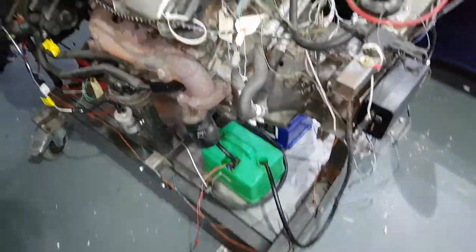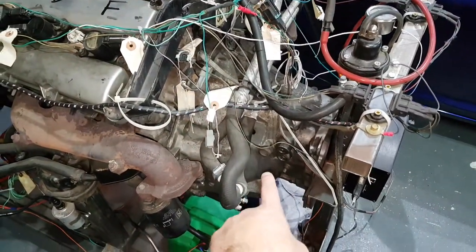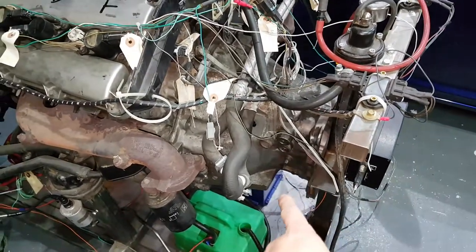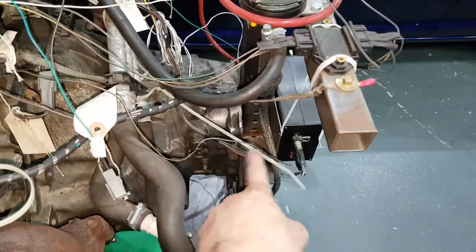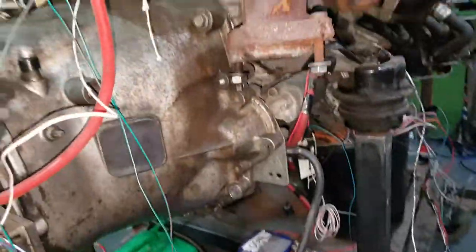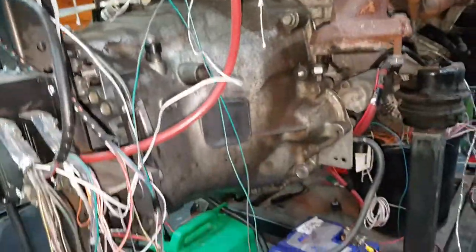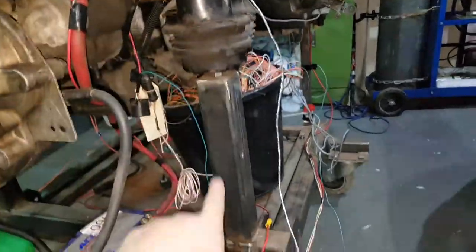Gav made the engine stand — got a design offline so he made that himself. We had to sacrifice a Jaguar 5-speed manual gearbox to make this work, which in hindsight is maybe a bit of a mistake because they're quite rare, the 5-speed manual gearboxes. We actually had to split the gearbox, which was a nightmare. The bellhousing means that we can run the flywheel and the starter motor, and then the bellhousing bolts to the frame. Standard Jaguar engine mounts just on these stands here.